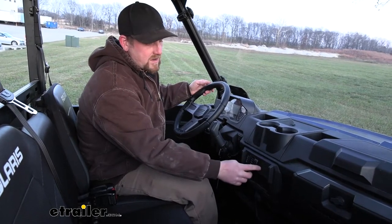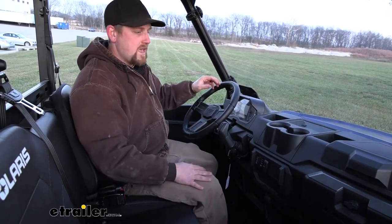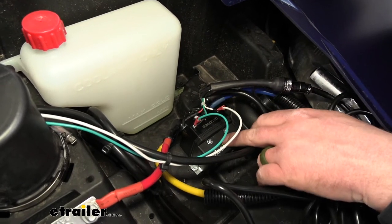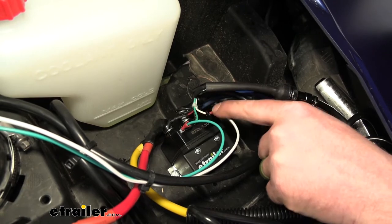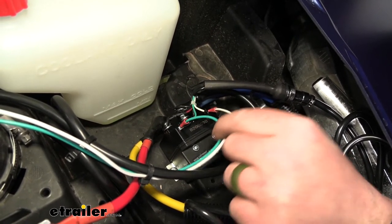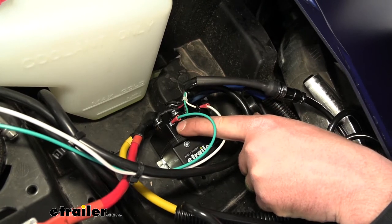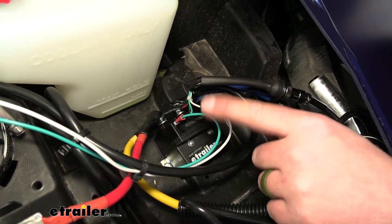You've got to mount the switch. In our case we have these knockout panels, so it goes perfect there. But if that's not your case, you can always cut a hole in the dash or mount it wherever you want, so it really gives you some versatility. To get the switch installed, we're going to start here with our winch solenoid. These terminals here, where you see the green and white wire hooked up, that's where we're going to have to connect. I used about four feet of green wire and about four or five feet of white wire — this doesn't come included, so you will have to get this separately. I used some small ring terminals and connected them to the switch here on our solenoid. Our winch switch is just going to operate our solenoid, telling our winch to turn off and on, and this just gets ran inside of the dash.